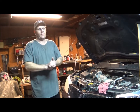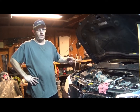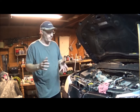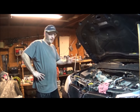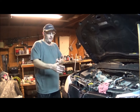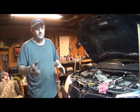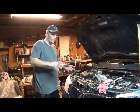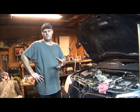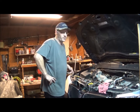What we've got going on — it's been overheating, but it hasn't really been burning water and it hasn't been losing water, which is the weirdest part. Whenever the head gasket was bad on my car, it didn't really act up until it got colder outside. If it was warm outside it would run pretty decent, though it used more fuel. Anyway, I'm going to finish up this compression check.